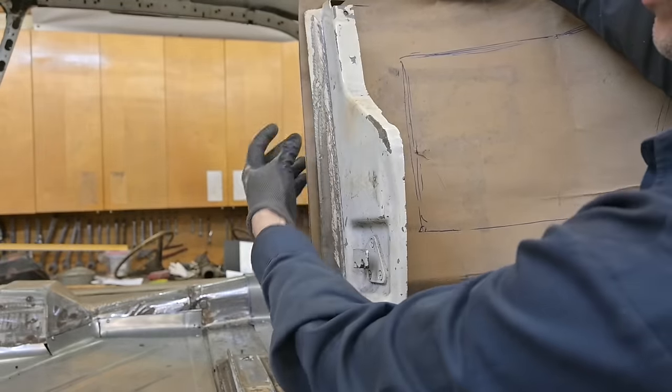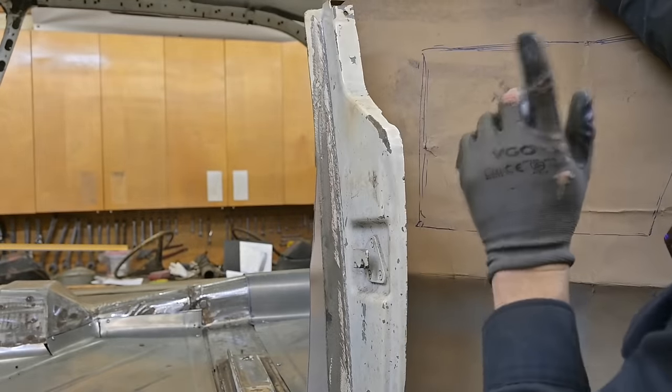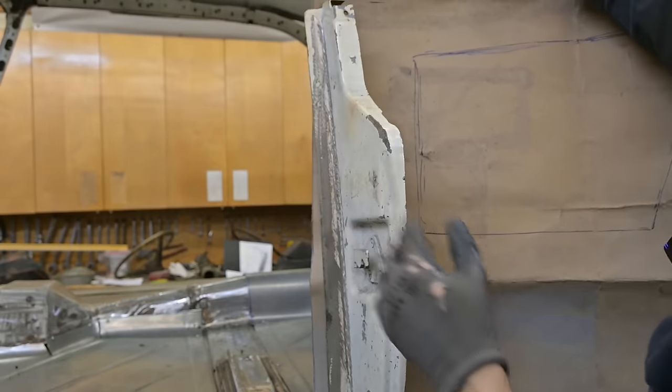This is what it's going to look like, roughly, right there. We have to create a hole here to access the power window mechanism. The back edge on the sheet metal will create a flange to tie into the tub. At the front we will spot weld once we set the web in place — spot weld to the post. We'll have an edge here for the seal to go on, and the top needs to be bent up to match the door, which has a specific configuration for the window seals and window wipes.